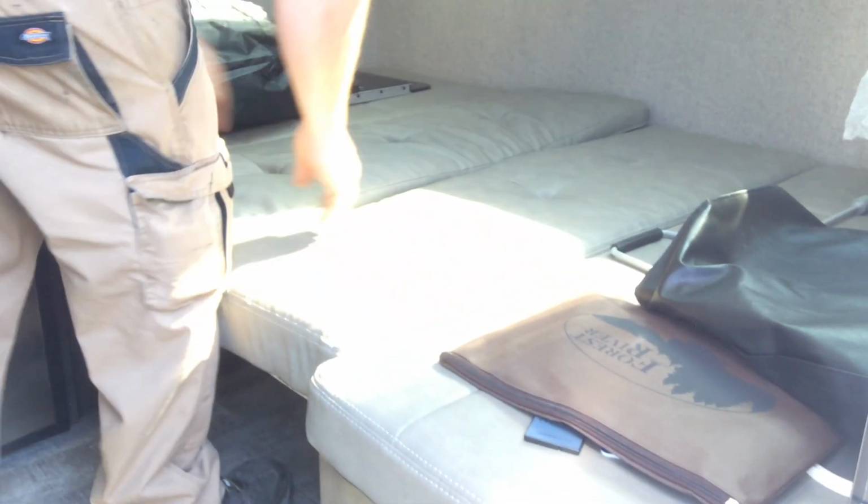As far as packing up your trailer, setting it up is the exact reverse. So what you're going to do is you're going to start by unlocking your back latches. Table should always be stored in the down position for travel. Releasing your clip on the wall. Coming down, the rubber puck here is going to set on the table.